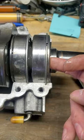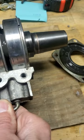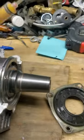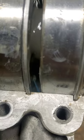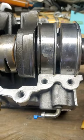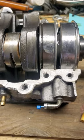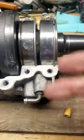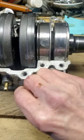Putting grease in the face of the first bearing isn't really doing as much good. Ski-Doo put this little zerk here — a little nipple. Pull this cap off and watch what happens when you take a syringe with a rubber hose with your Isoflex and hook it up right on this. See where that grease is coming out? Right in the middle of both of those bearings. As you're injecting, have a buddy slowly pull the recoil with both spark plugs out so it rolls nice and slow, and the grease rolls right around in there. Check your manual — 10 to 15 milliliters every other year, whatever they recommend; don't quote me on those figures.